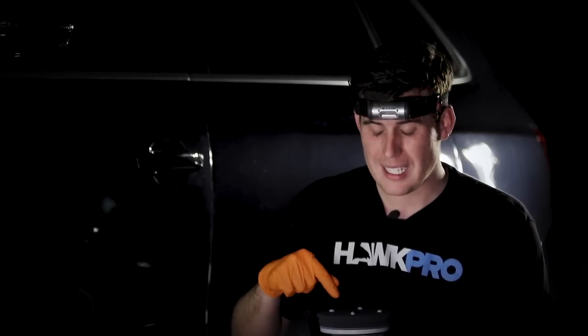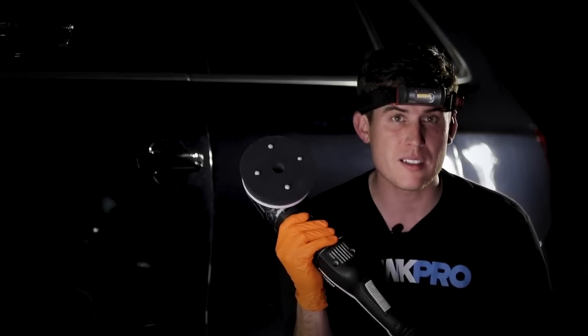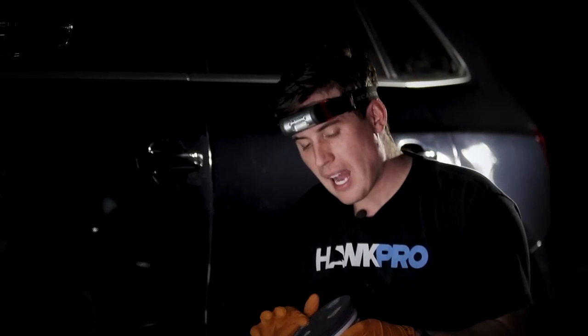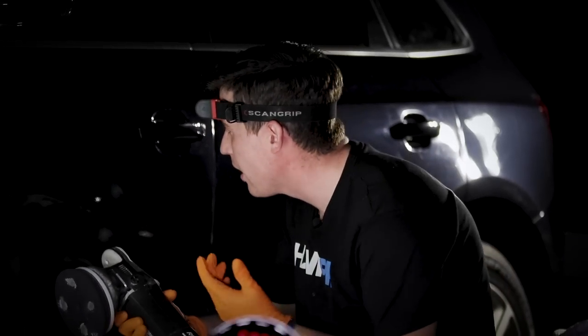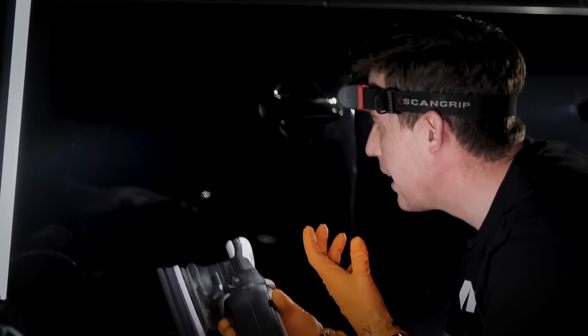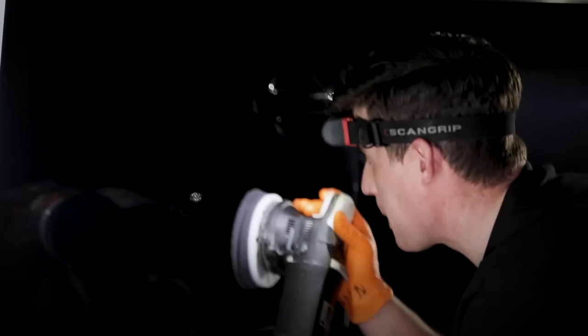Let's say you've got your cutting compound of choice, but you take my word for it that M3 with a purple pad is the bee's knees, because it is. You're going to want to use basically the same technique. I've got 4 dots on my particular purple polishing pad, and I'm going to go to this dry panel, which I've already compounded, and it's the same basic thing. I'm going on speed 6, whether you're using a Flex Force rotation or a Rupes Mark III like I've got here. You're going to do the same thing, and it's going to be easy, and the ticks are going to be gone.